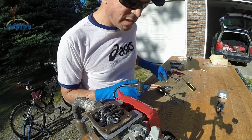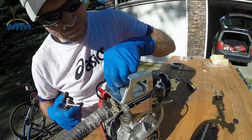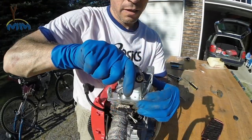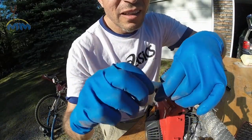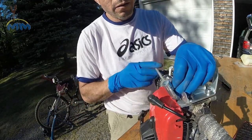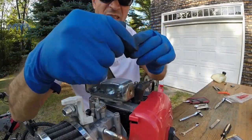So now I've properly spaced my valve clearance according to specs and I'm ready to reassemble the motor. I'm going to put that valve cover on — try to make sure it's straight and don't want to strip them. You want it to be nice and tight but not over-tight. Make sure that this little nub is screwed all the way down, because if the circuit isn't properly met in your spark plug your motor's not going to turn over the way it should. Get your handy-dandy spark plug tool, put that on, don't over-tighten it. Put the wires back together.